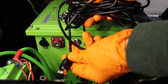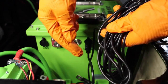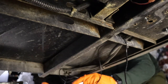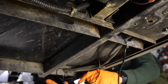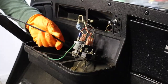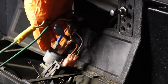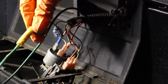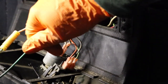Plug the state of charge meter wiring harness into the display port. Route the harness along with the extended green wire from the 12 volt reducer up to the dash area. Keep all wires above the bottom of the frame by securing them to existing wiring harnesses. Remove the TXT cup holder and access the key switch panel. Identify the cold side of the key switch and secure the green wire in using a dual spade connector or wire jumper. This will activate the 12 volt supply when the key switch is in the on position.